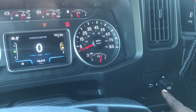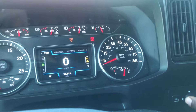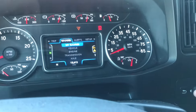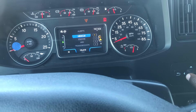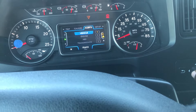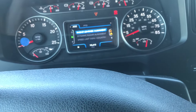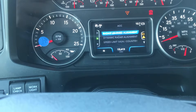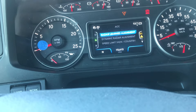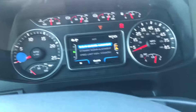You're gonna see right here — go to the lever on the side and go across to the right. As you can see it's moving as I scroll with my finger. Pull back to Vehicle Setups, then find ACC. It's basically telling you to go to Radar Learn Alignments, and press the OK button.